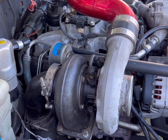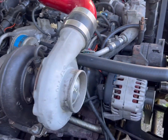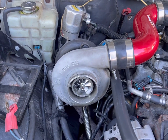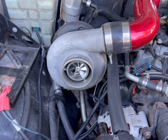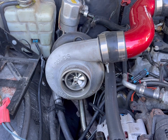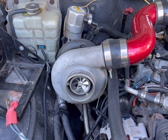Going forward I'll probably put a Borg on whatever I build. If I do a sled pulling truck similar to this, it will actually be the next size up — I'll go to a 63 — and that way I've got a little higher volume of air, and I'll do some torque converter work to make it spool a little bit better on the top end.